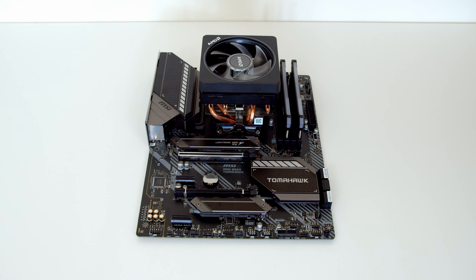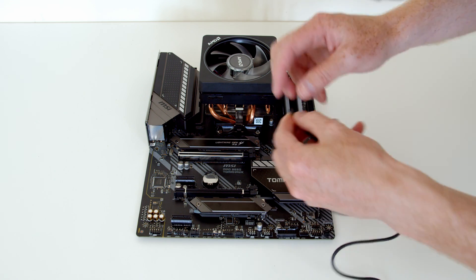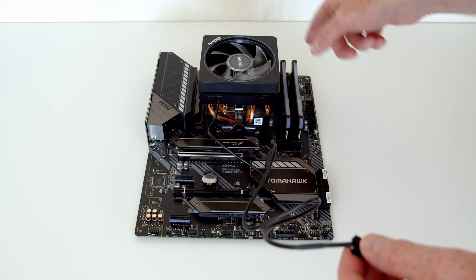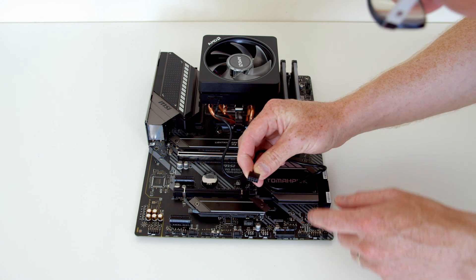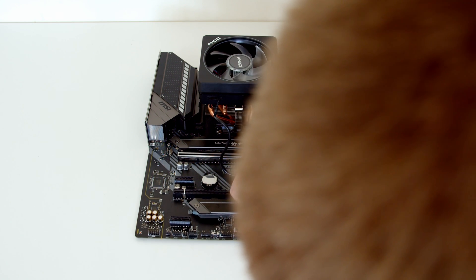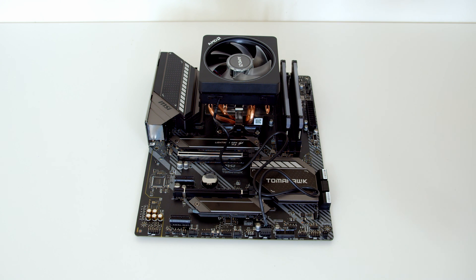If using the USB option, first plug into the three-pin connector on the bottom of the cooler — that's now secure and in place. Ideally route this cable back around the motherboard out of the way. The USB 2.0 headers are down the bottom of the motherboard. Note that one hole is missing on the pin and one pin is missing on the header, so you have to line it up the right way before pushing it in. Ideally this cable runs out the back of the motherboard, around, and back in. A link to the required software will be in the description.